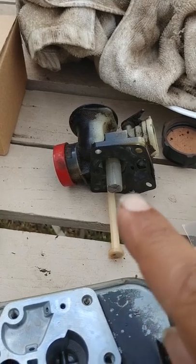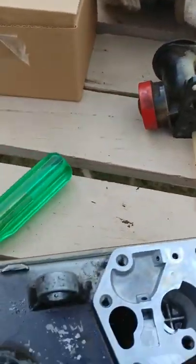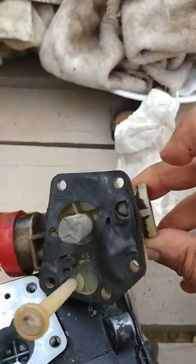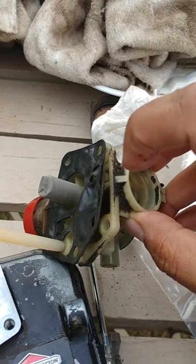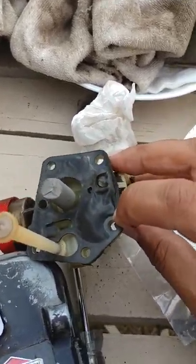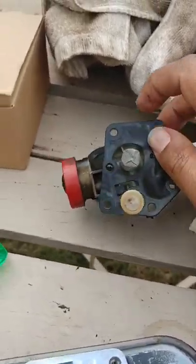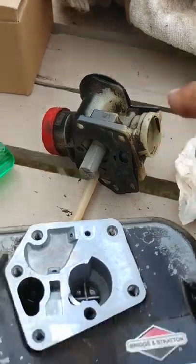I'm just cleaning it - the carburetor, I've just cleaned this. This can come off and I've rinsed it in some petrol from the tank. I've also cleaned this a little bit. It makes me question why this happened. Looking at this carburetor, the gaskets look okay, but over here where the diaphragm is, see how it's a little bit thin on this edge. I wonder if the dirt got sucked in through this diaphragm and into the chamber, because there's an awful lot of dirt. Can you see how the gasket's thinning? The rubber diaphragm is thinning there - maybe that's why all the dirt got into that chamber.